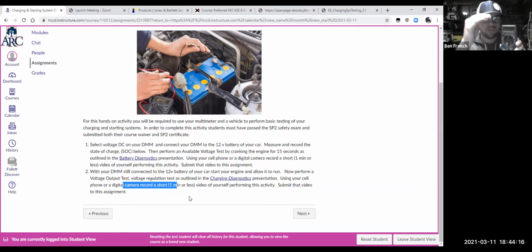I see what the voltage drops down to. I want it to be above 10.5. And then once the car starts, I expect the voltage to jump up, to somewhere above 13. Once it's running, rev up the engine a little bit, right? Rev it up to what feels like 2000 RPM or so, so you know the alternator is spinning adequately fast, and see, is that voltage between 13.8 and 14.8 volts? And if it is, that tells you that everything's looking pretty decent with this thing right now, right?